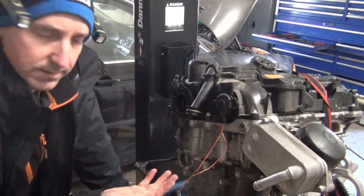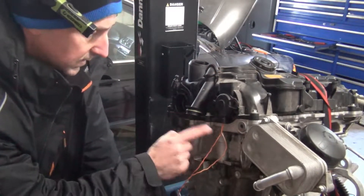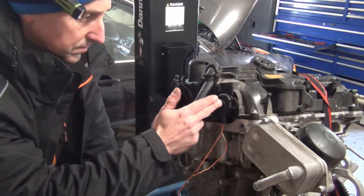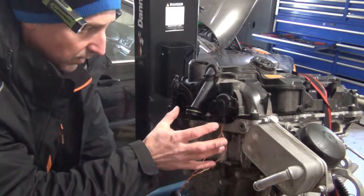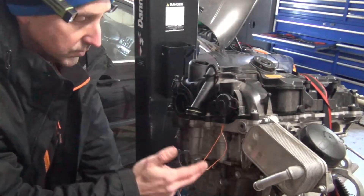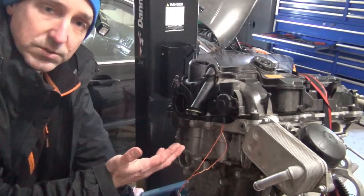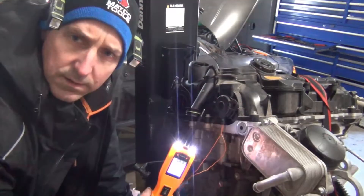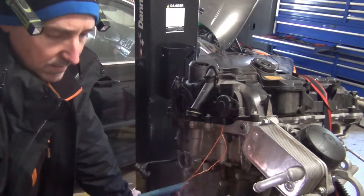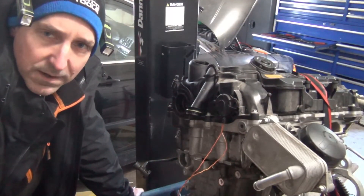That's all there is to it. If you're having a Vanos fault, you can swap these side by side, swap the sensors side to side, and see if your fault follows from intake to exhaust. When you activate it yourself and the engine bogs down, that's telling you that you have good oil pressure, the solenoid activated, and your Vanos unit did activate — so you can rule out multiple components in one shot. Hopefully this was helpful for diagnosis or swapping on a BMW N20 engine. If you're interested in this KZ Power Probe, I'll put the link in the description. Thanks for watching — a lot more to come!